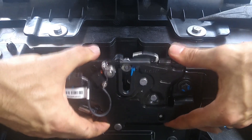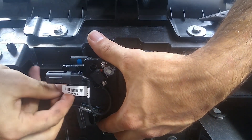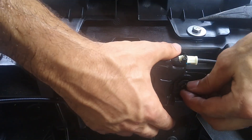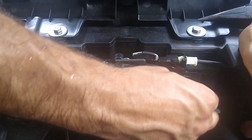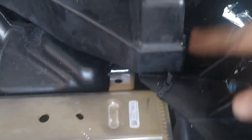So where does this go exactly? Let's put it halfway and then we'll just have to guess and check. Before we put the frunk tub back in and all that, we'll test it out a couple times. One of the biggest questions is where do we route this cable? I routed it here behind the headlight and did double zip ties — one here, one here. This one is going to the actuator, and this one is for the emergency cable.